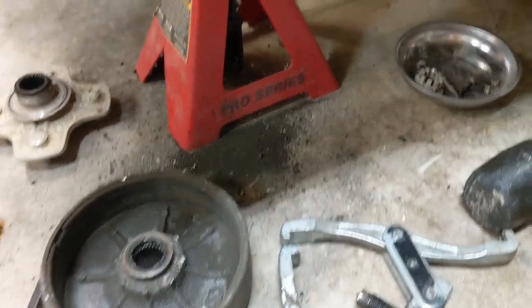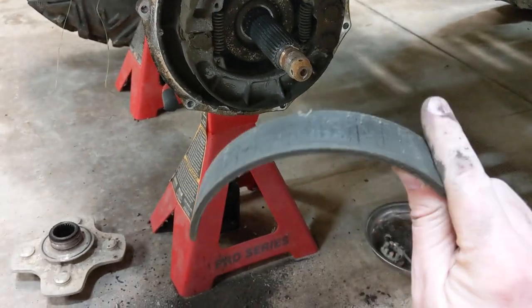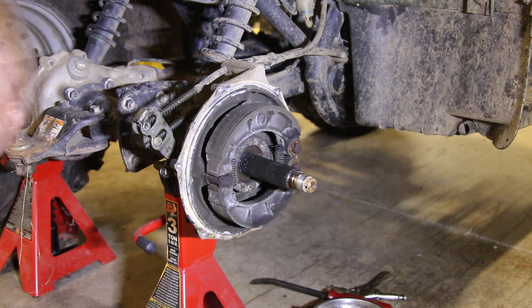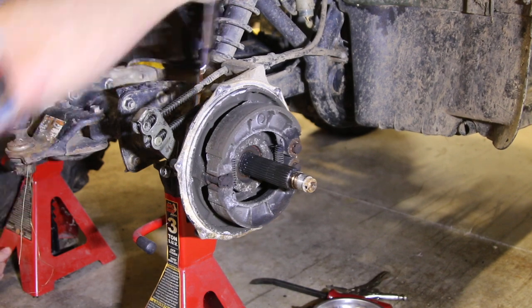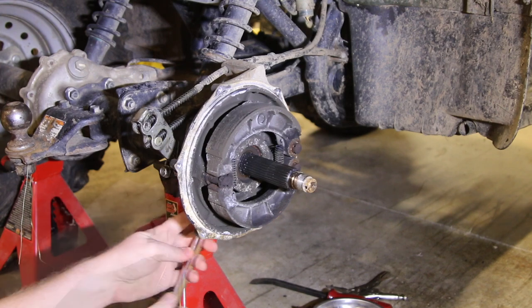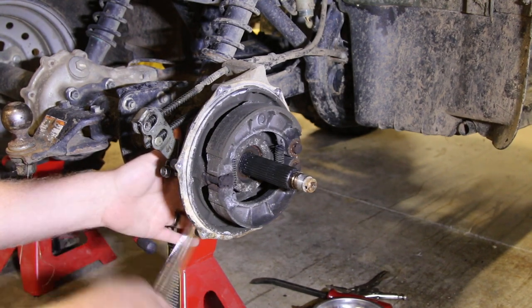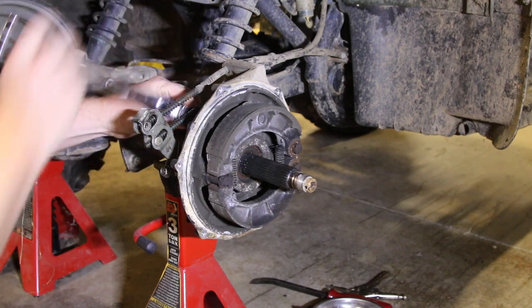More brake dust, and then the best part — yeah, it's gonna need new brakes. The instructions say to remove everything and keep all stock components removed, which is awesome — that means this is a complete swap, which is exactly what I wanted because all of this is trashed. There's a 9/16 nut back here, looks like there's four of them. Not too tight. This long handle on this gear wrench ratchet makes it much easier — I love this gear wrench. Had a bad experience with Craftsman, switched to gear wrench many years ago and haven't looked back since.